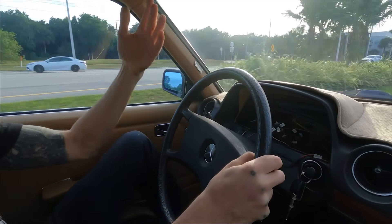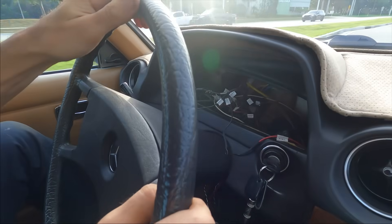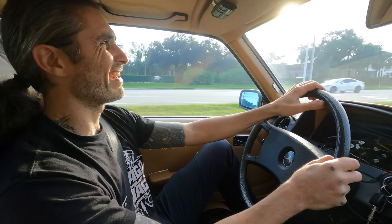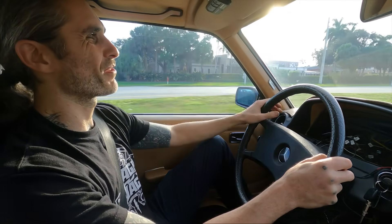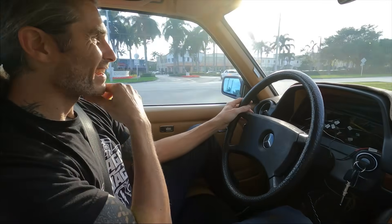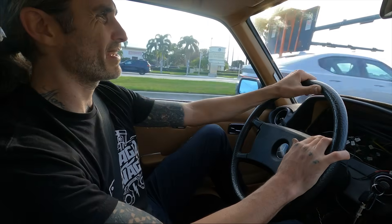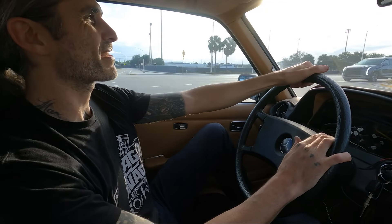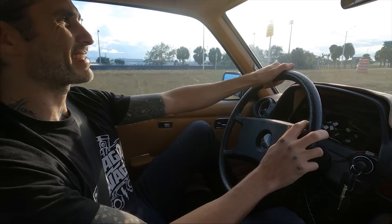I don't have any instrument controls yet — I'm still building up my new gauge control in the cluster. I know that everything works from the previous iteration of this system. A lot of people have been commenting: why are you swapping batteries, EV batteries go bad so fast, why do you need new ones? Well, my old EV batteries — Chevy Bolt batteries — are just fine, but they aren't very energy dense, so I really wanted to build this car so I could travel more than 80 miles at a time.